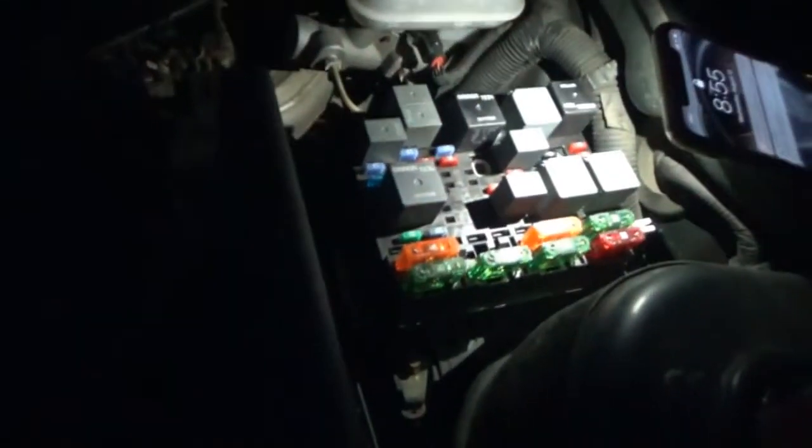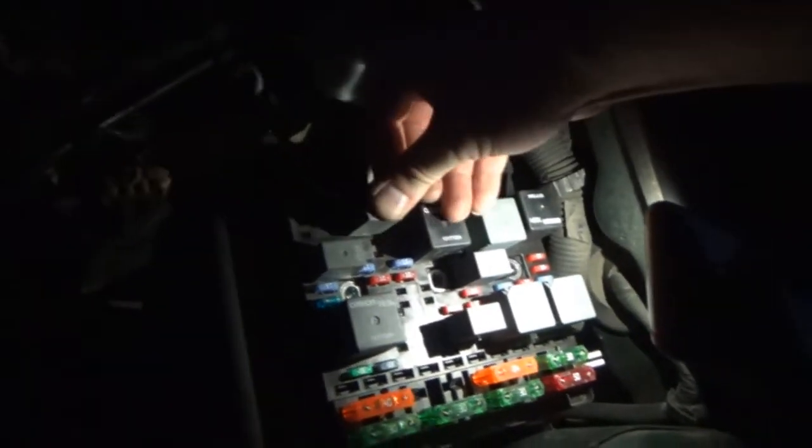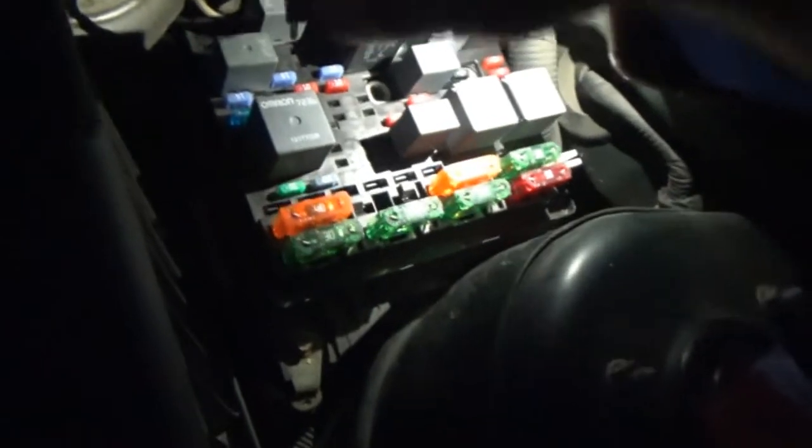Like I said, I just thought that was kind of a cool thing while it was nighttime. Something I came across while I was out here finishing up that wiring. And I'm glad it just turned out to be a relay with the automatic headlights. So this is the good daytime running light. Put that back here. This is the bad one here. We'll put this one back.